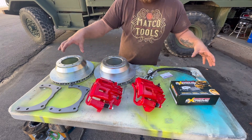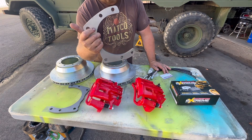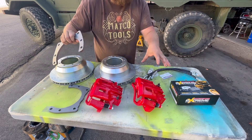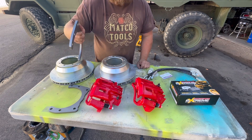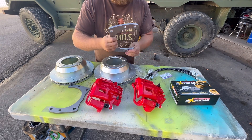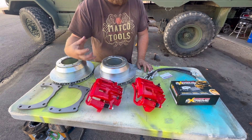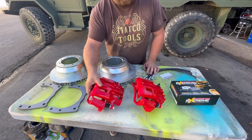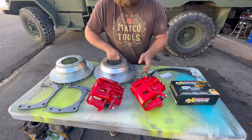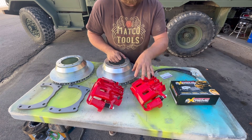Here's all of the parts kit that we're using to get this job done. These right here are the brackets that Keith Walagura makes — I'll put a link to all of this down in the description. Those are the Keith Walagura brackets; you'll be able to bolt the calipers onto the axle. These are 2000-2004 F-350 dually rear calipers. Same with the rotors, same with the pads — so that's all the 2000-2004 calipers, rotors, and pads.